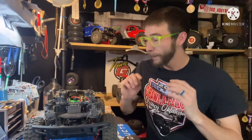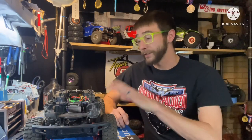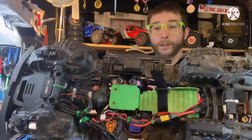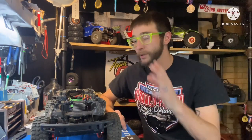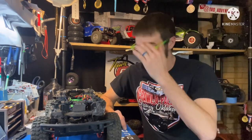First things was the stock motor and ESC combo. I just never had the best of luck with the stock Traxxas electronics on my TRX4s or the servo. That was definitely one of the first things I meant to address. I did the motor and servo right off the bat. I went with the Castle Copperhead 10 crawler combo with a 2280KV brushless motor. Keeping the stock pinion in there now. I was debating going with the 2850 or the 2280, but with the 2-speed, the 2280 does just fine. The Copperhead combo is definitely becoming a fast favorite ESC of mine - it's super powerful and super smooth.